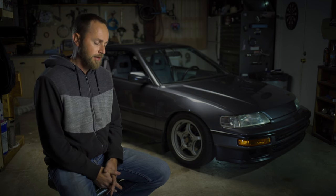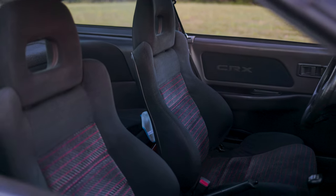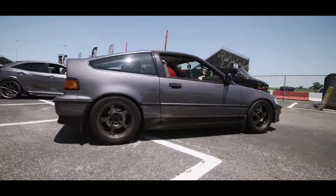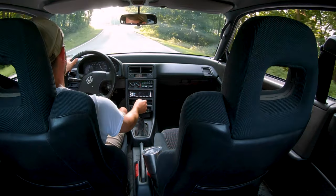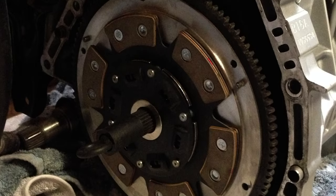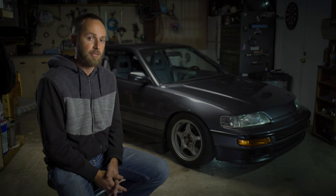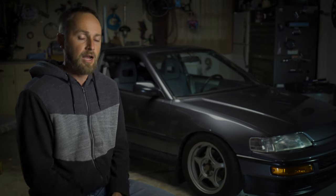The car is not a daily driver, and being a two-seater with two kids I only have limited time to enjoy it. But anytime I don't have the kids with me, I take it out and use it as much as I can — I'll even put drills and tools in the back and take it to work. The car has been to three Import Alliance shows and I've been in a showcase once in St. Louis. It handles like it's on rails — it's like a street-legal go-kart. The transmission doesn't have LSD but it is a B16 first through fourth gear with an LS fifth — short tight gears for quick acceleration and then a highway fifth gear. The car still gets 35 to 40 miles per gallon on the highway. I'm still running cable clutch but I put in a new pedal assembly reinforced with the Hush Performance Hydro pedal assembly.